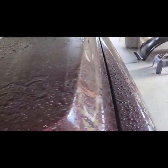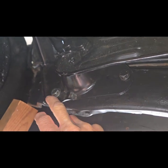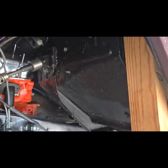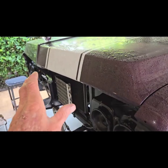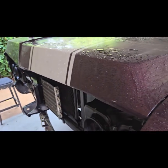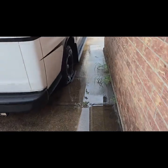The hood is looking good except when I close it, this side still stays up. The hinges did not have slotted holes — they are just round holes. So I'm going to take the hinge back off and drop the back of the hinge down a little bit. That should set the hood down. Next up: put the headlights in, get the wires hooked up, get the grill in there. But before I do any of that stuff, I have to fix this.